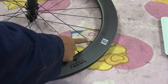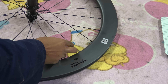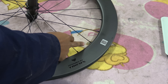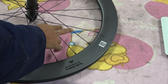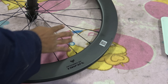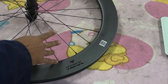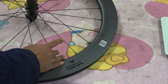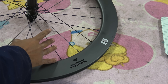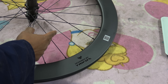Spokes are steel and the nipples are not hidden at all — you've got a good 5 or 6 millimeters plus in there. The spokes are square; they're pillar spokes. Looking at all of these, they're in line. Spoke tension is fairly even across it. Because they're steel, the wheel doesn't ride as stiffly as some of the other ones I've had. But even the front wheel is heavily laced, and it needs to be because it's a disc brake.